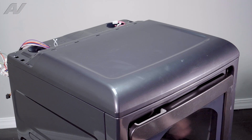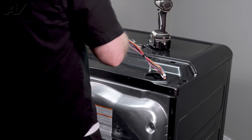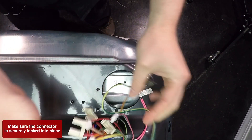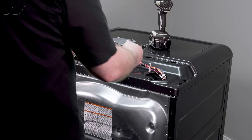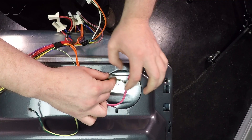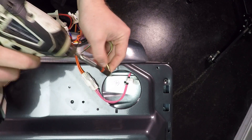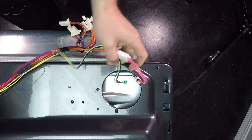Close the door and return to the back. Now that we're at the back of the unit again, set everything we'll need right on top. Pull out the harness, slide it into the strain reliever, and twist it back into place. Reinstall the bottom molex. If you remember, we had a ground strap that was screwed in — there's one main ground strap with a square end and a circular end. The circular end is the one that gets reinstalled inside the chassis. Pop the screw in, bring it in, and drill it down.